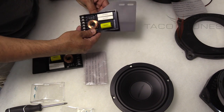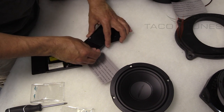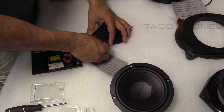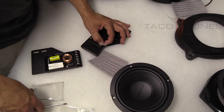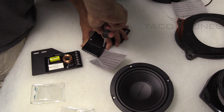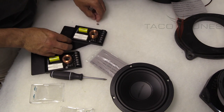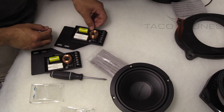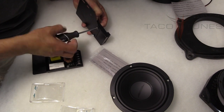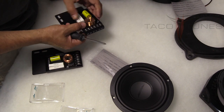Put the terminals facing outward, away from the mount. Then this one — notice it's going to be a kind of tight fit; we did this on purpose. Take your Phillips and kind of force it in there just a little bit — won't take much pressure. Next, put the nuts on, tighten it up, flip that over, tighten that up, and do the other one.